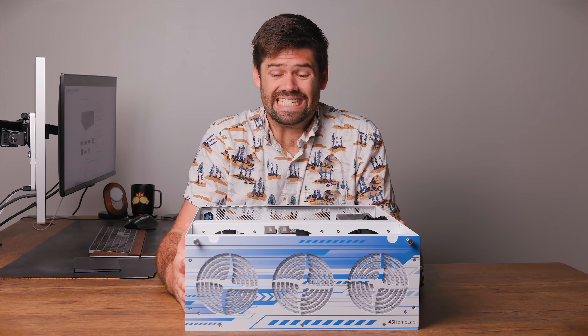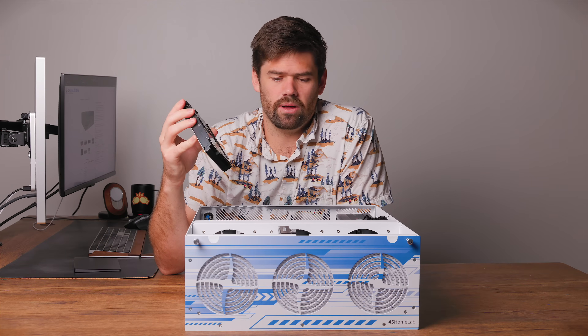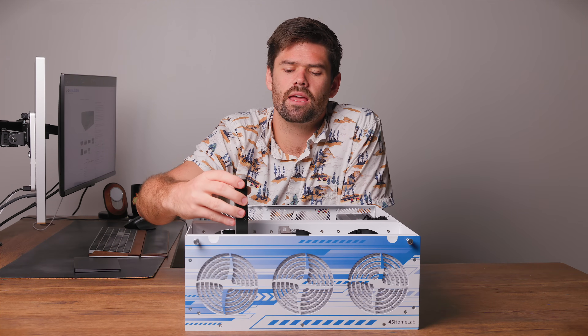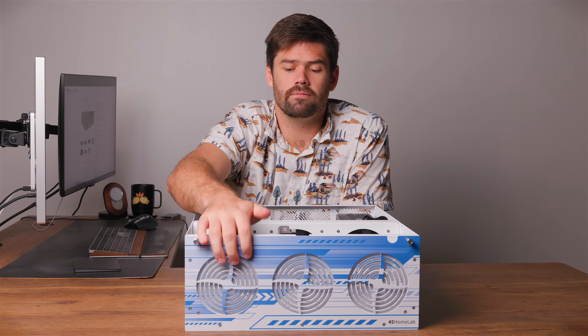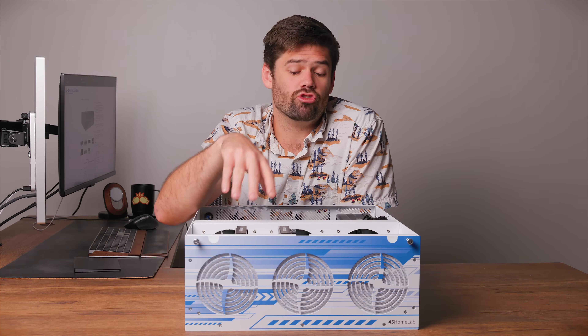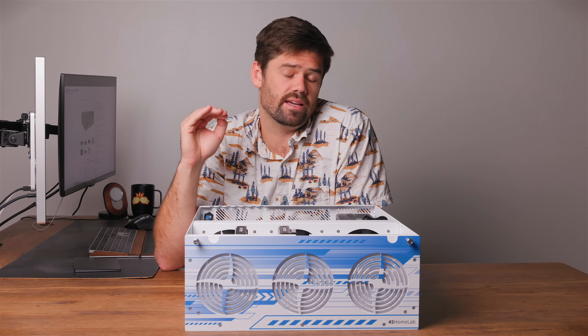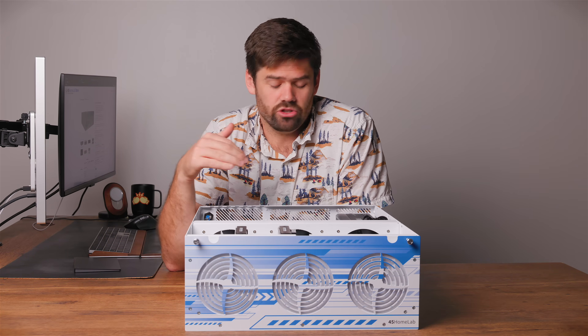This thing, as the name suggests, can store 15 drives, and the way they work uses a completely tool-less, caddy-less design that I've not seen before but actually works quite well — you just slot the drives in directly like that. By far the easiest drives I've had to install, and so far I've had no issues whatsoever. Every single one of these 15 drives up front is directly wired into the HBA, while leaving six more 16-wide PCIe slots for whatever you want to do — that's the real advantage of AMD EPYC and its massive PCIe lane count.